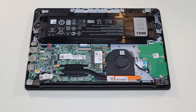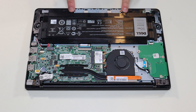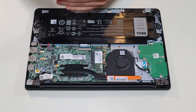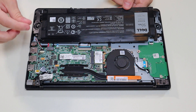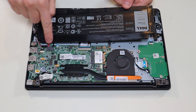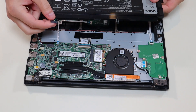Before I touch anything inside a computer, I always either remove or at least unplug my battery. Since this plug is so tight with the battery, it's going to be hard to unplug it without removing the battery, so I'll show you how to remove it now. It's held in by these two screws on the bottom, this screw in the corner, and this screw on top. After undoing those screws, the battery can come up just a little bit. Even though it's best to never actually pull on the wires when unplugging something — you always want to manipulate the plug and not the wires — this one is so short with no real grips on the plug, so you would have to just slowly, gently wiggle it out, which is not ideal. But in this computer, that's what you have to do.